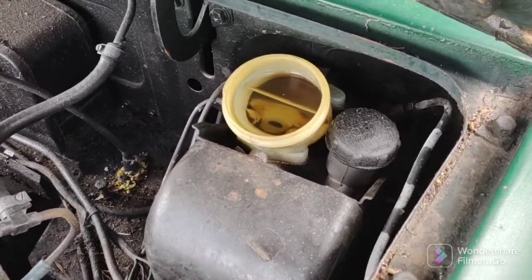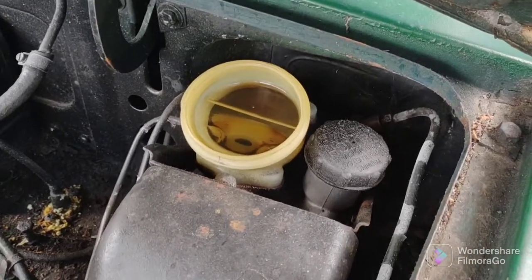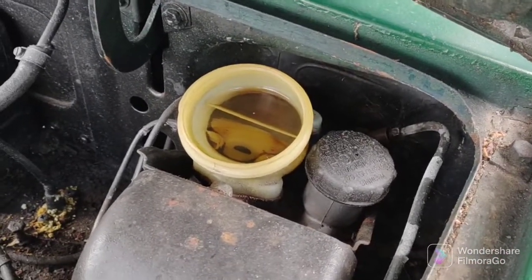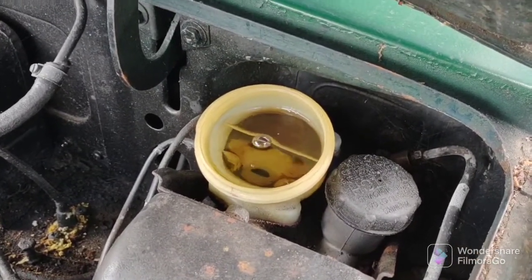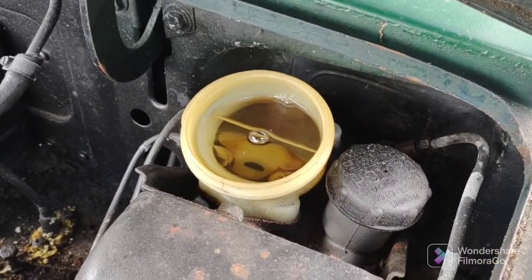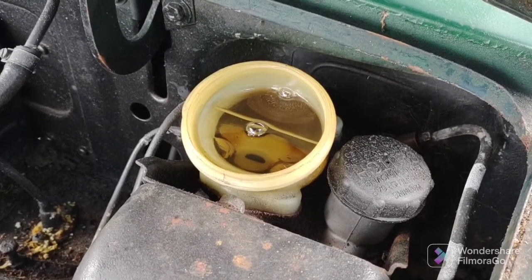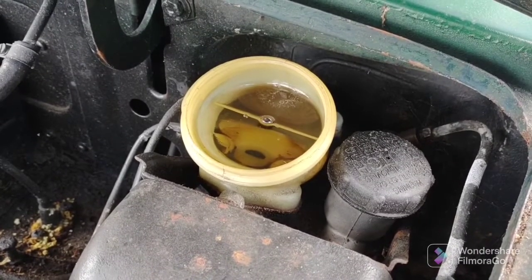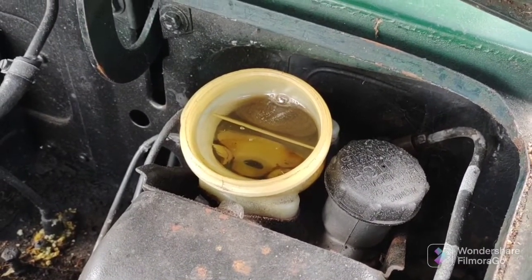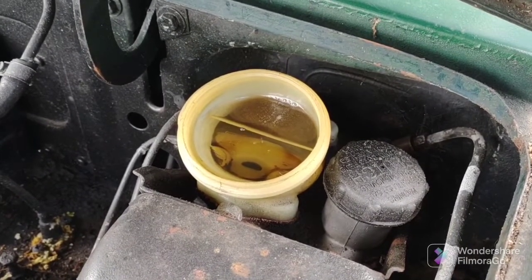I have a helper in the car, and I've been pumping the brakes. I added fluid. So please pump the brakes — just on and off, little by little. And look, there's bubbles — a lot of bubbles, a lot of air coming out of the master cylinder.